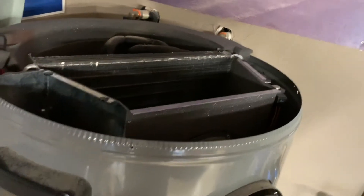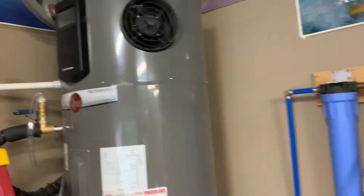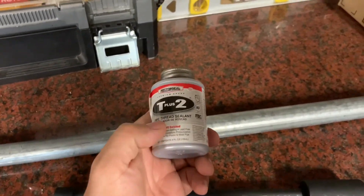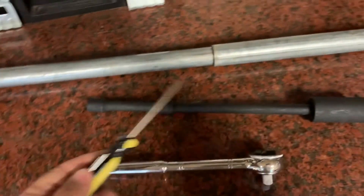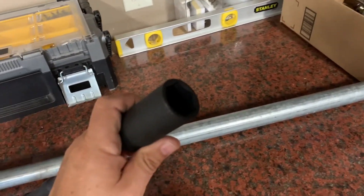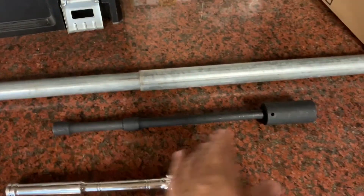The extension needs to be at least 14 inches so it can reach to the bottom and give you leverage to pull on it. You'll also need a 27 millimeter socket or a 1 and 1/16 inch socket — both will fit just fine. Make sure you have an extension that gives you at least 14 inches of clearance.